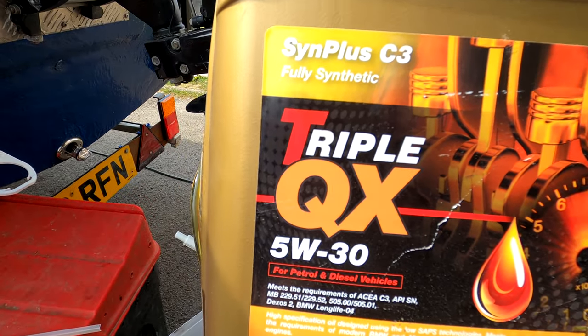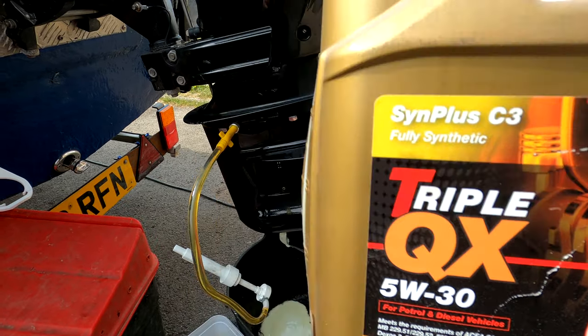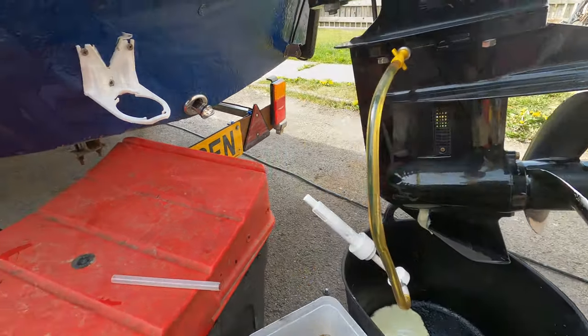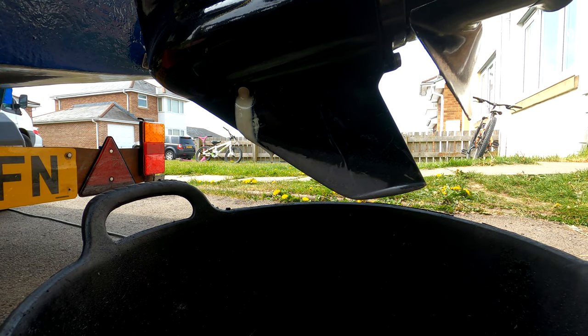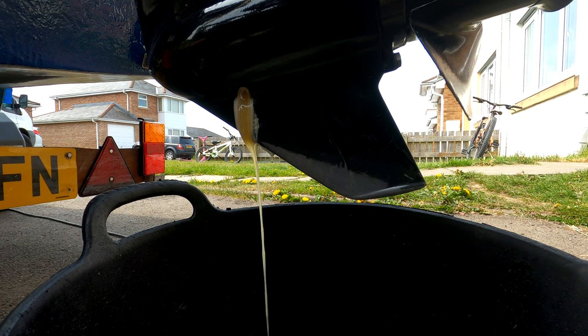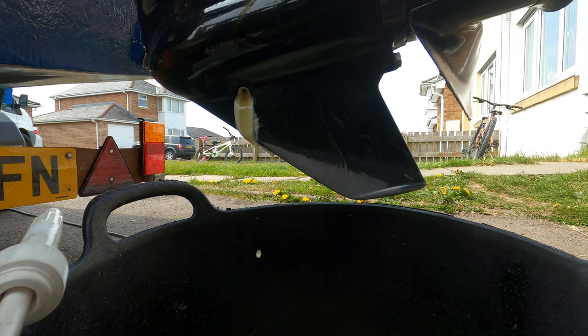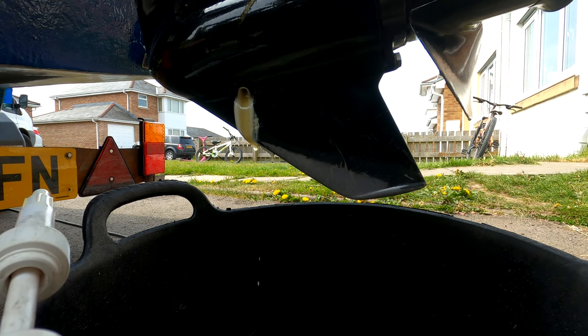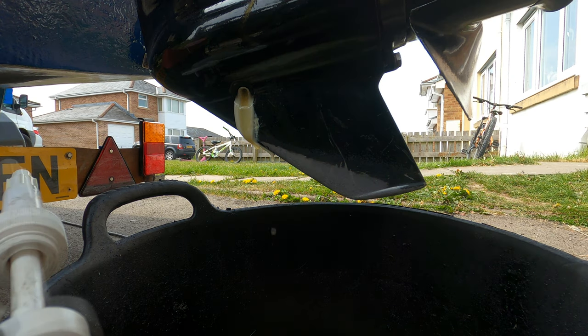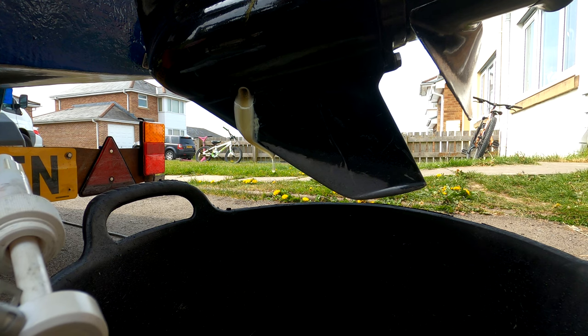That's the stuff I'm using — nothing special, just a bit of spare 5w30 oil in a tub. It's pretty thin so hopefully it'll help to flush out a lot of this. I'm going to pump it through now. What I might also do is fill the gearbox up with 10w30, run the engine on the driveway, and put it in gear just to circulate a bit of oil around the box to get as much cream out as possible. When we pull the assembly out, we can clean the rest of it.